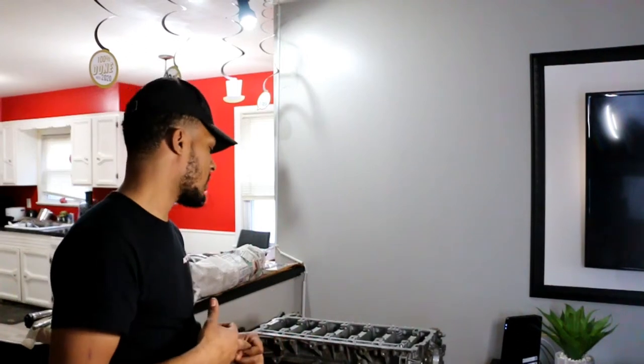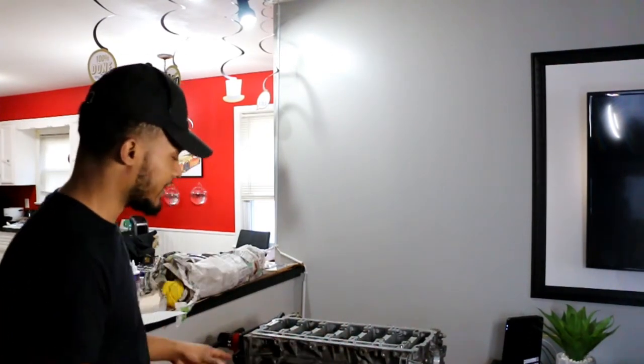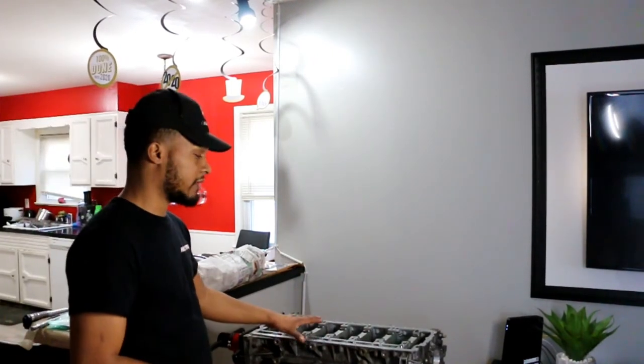What's up YouTubers, I'm back with the M Killer series. I know I haven't been posting lately — it's been hectic working two jobs and editing is difficult. But behind me I have an N54 block that I disassembled. I had the motor sent to the machine shop — had the block cleaned, decked, repaired some broken threads, and had pistons and rods measured and balanced. Right now we're focusing on installing the crankshaft. The engine is in the engine stand and the bed plate is on there temporarily.